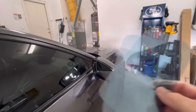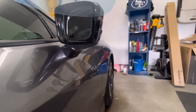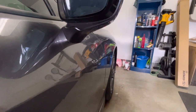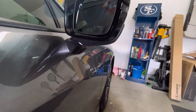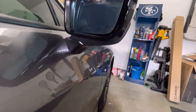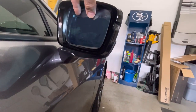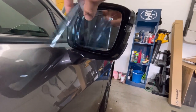You simply peel, spray with a solution of a little bit of water and soap. Put it on there, line it up, and then squeegee the moisture out. I like these — they have a little blue hue to them, which a lot of cars actually have.